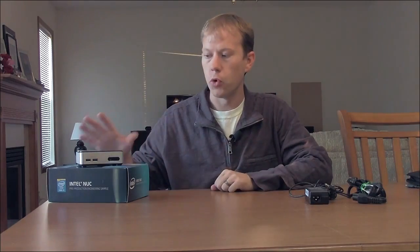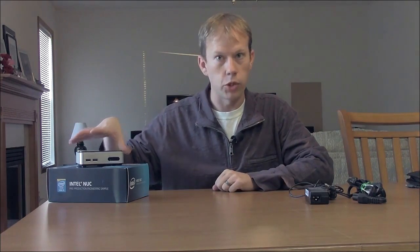Okay, now if you have the NUC, you have the first few things that we're going to need. You have the power supply, and you have the cord. I'm assuming here, if we're going to build a set-top box, you're going to buy the kit that comes with the chassis. But it's also important to point out that this is also available with just the board. And the board has the processor and all that other stuff on it. So if you just get the board, you could take that and build it directly into a display or any other kind of custom chassis that you want. So you don't have to have it as its own little box. Now, what we're also going to need to do is provide our own storage, wireless, which is optional, and memory.